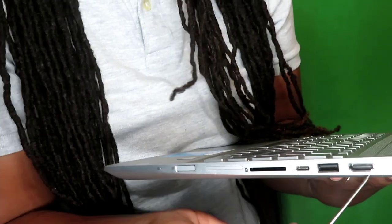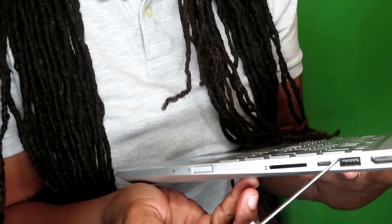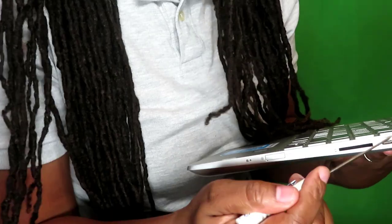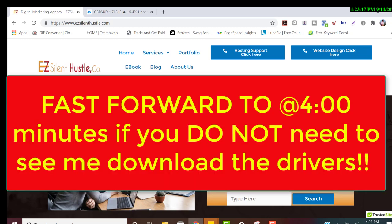So what you're going to do is hook up one of your HDMIs into the laptop, with the other end going to monitor number one. Then hook up the USB adapter here. Important: for those of you buying the USB-to-HDMI adapter, you need to install the drivers before plugging it in. I'm going to show a clip of me installing the drivers for the j5 Create. Check the description to fast-forward if you've already downloaded your drivers.